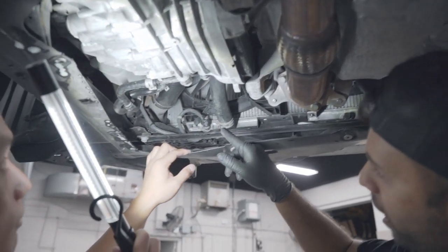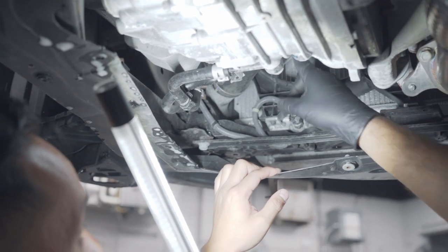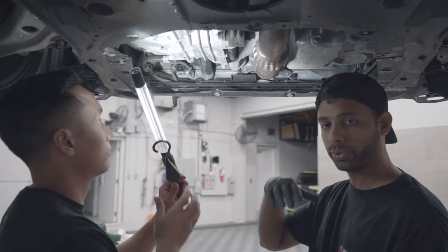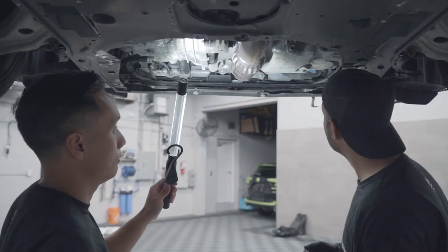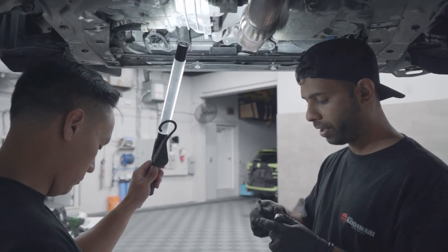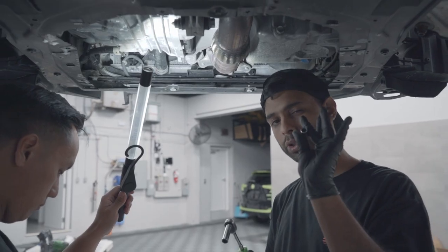On the opposite side right here is the cold side — that's where the hose will be going up into the engine bay. We'll be attacking the top half shortly once we're doing the inlet and the intake. We're going to use a small quarter inch with a 10mm socket. We'll start with the long, then go to the short.